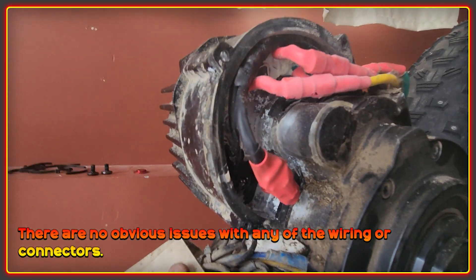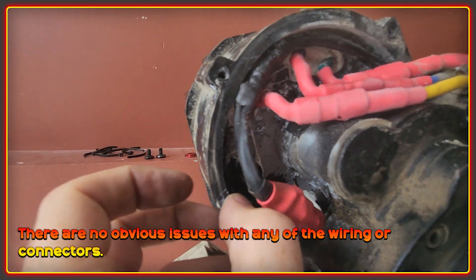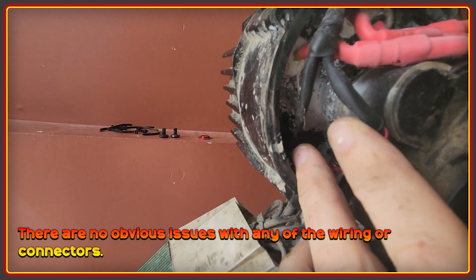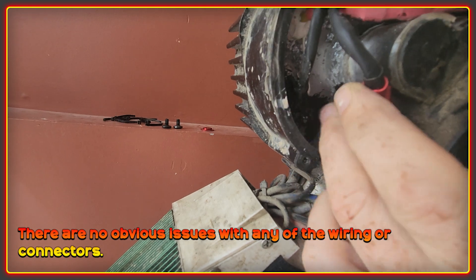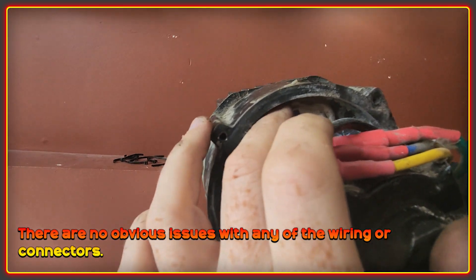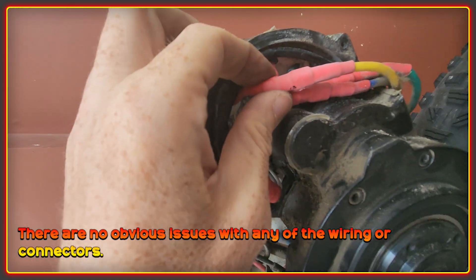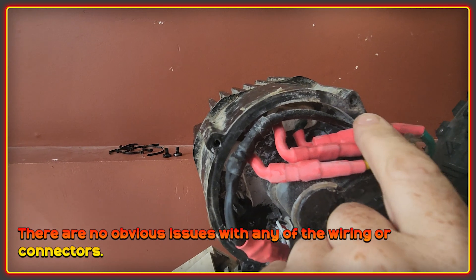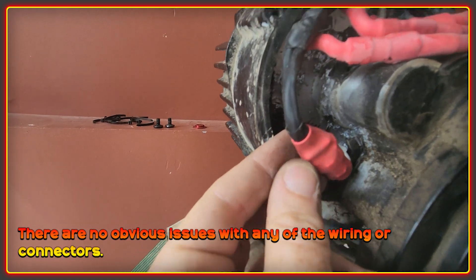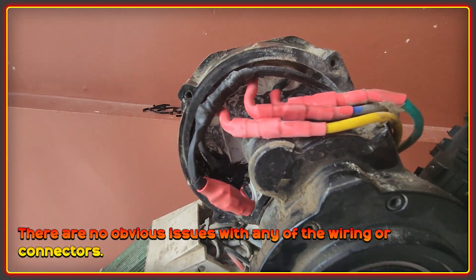I'm really pleased to see inside here — it looks great, there's nothing inside here at all. Still intact is the liquid electrical tape that I put over the Hall sensor. I used silicone all the way around these, which did a really nice job of keeping this all sealed up. The connectors with heat shrink still look great — this is the Halls one. It's actually going to be a shame to take all of this apart, but I'll have to do it to remove the controller.